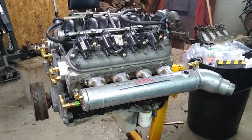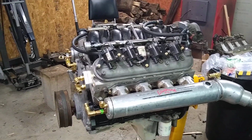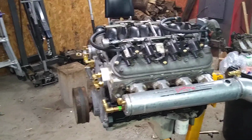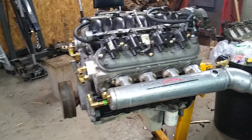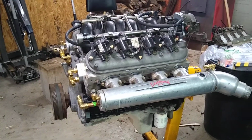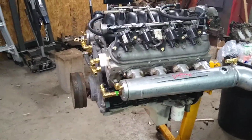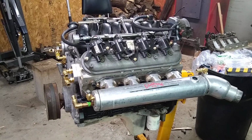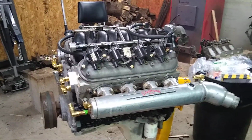And start getting the thing sealed up in terms of the intake and the pump, the suction housing, everything. I got all that stuff all prepped. I was going to run all of it through our big blast cabinet, the suction housing, the transom housing, the bowl, every part of the pump we completely disassembled and then taped up where necessary. It's all going to get blasted in the cabinet with aluminum oxide. And then I was thinking about taking it over to these guys that we deal with here and there that do powder coating, and have them just powder coat the entire pump in black. The pump would look sweet, like gloss black.